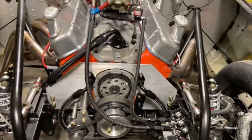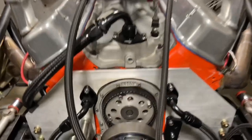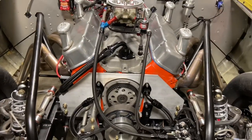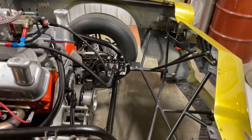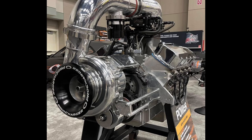I really love how clean all this looks, and I love the black — I think this really turned out well. That's how it all circulates: it goes through the block here, comes out the intake, and everything has been perfect. All this room up front is great to have and we will be utilizing it soon, because when you have a big blower like this hanging off of your engine, there is no room to have the standard position radiator. When you scale this car and that radiator is in the rear, it just makes the world of difference. This is our first year no prepping and we've already won two races, and I think that radiator has a lot to do with it — especially with 54% on the rear, you're going to hook up and go, and it's going to drive very good on the big end.